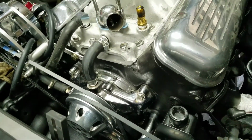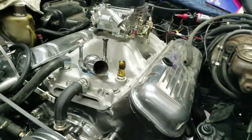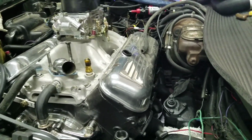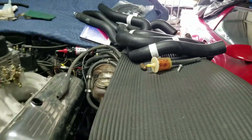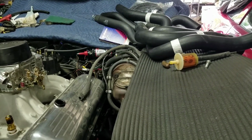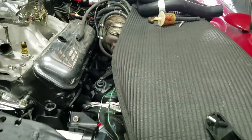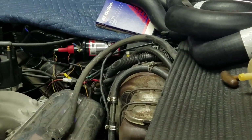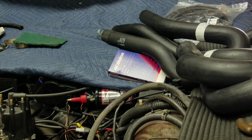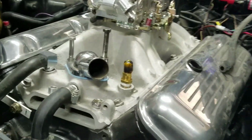But after the power steering pump and the fuel lines are done here, and I've got the carburetor to still plumb up, and then the coolant hoses, I'll be able to get some coolant in here. I went through a lot of hose trials there at the store to see if anything would work, and I ended up getting these aftermarket ones for the big block GM. They're GM stamped. This upper hose is laying with all of them there. It's got a GM stamping, and I was putting a spring inside so that the tube doesn't kink or anything. And that'll line up this inlet here.